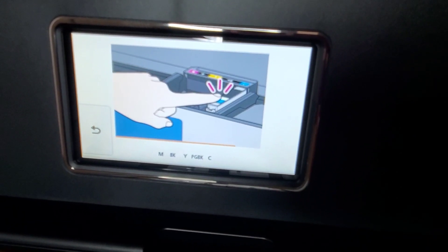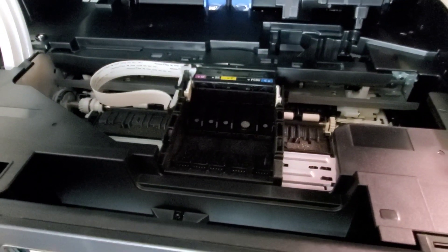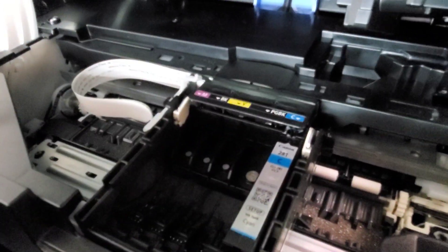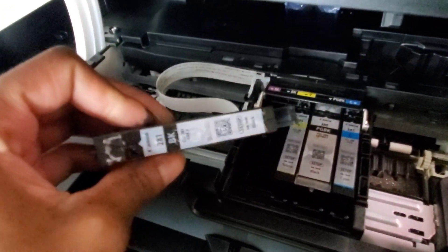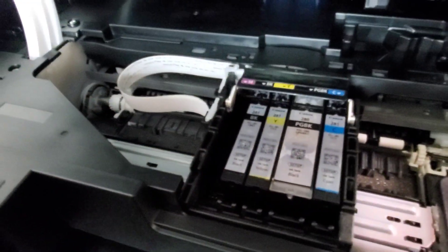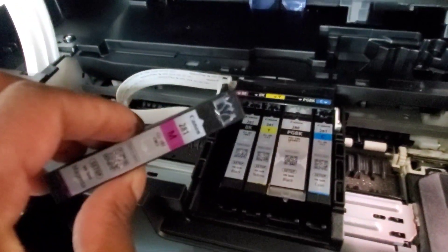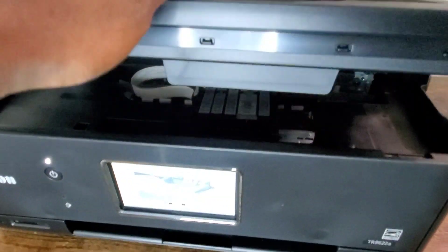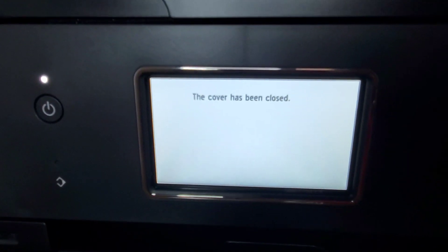On the screen it's going to display how to open the ink cartridge chamber. You just lift it on the side and wait until the cartridge placement stops moving, then insert them according to the color shown. Please make sure you watch what color you insert. As you place the ink cartridges in, make sure the color side is facing up and the gold chip side is facing down — insert from the color side up and then slightly push down.